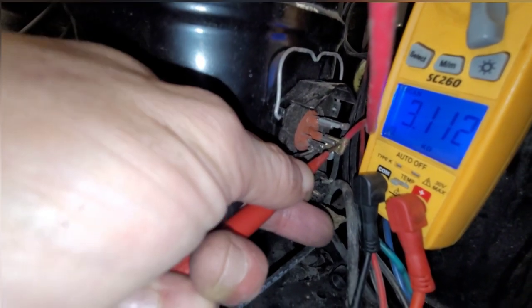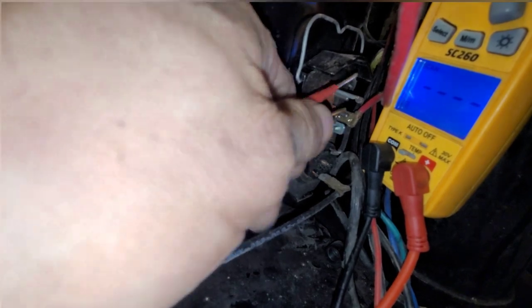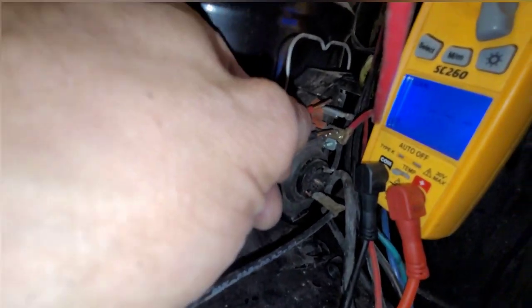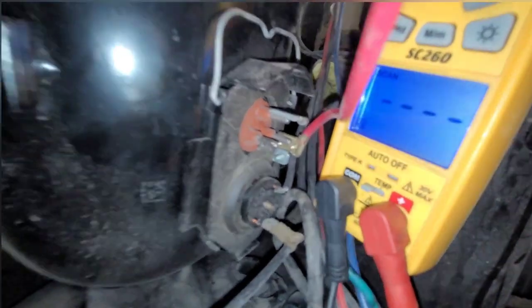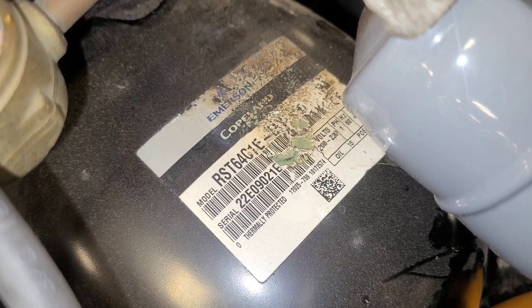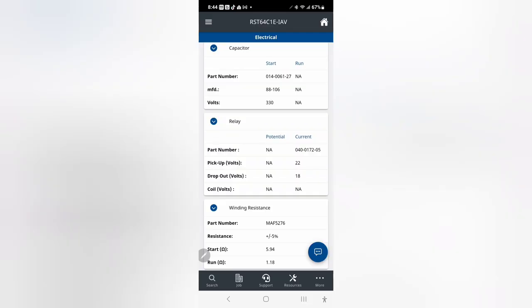You always want to make sure that your wires are off of at least one of the terminals you're testing — that way you don't get any back-feeding resistance. That's how you diagnose a compressor. This little compressor also had dirty condenser coils, which I believe helped kill it.